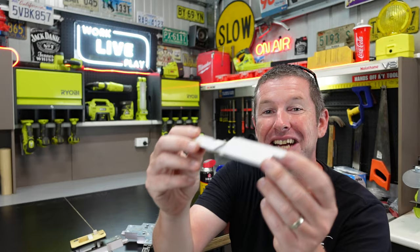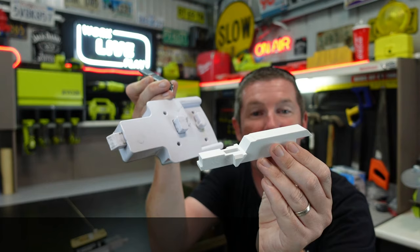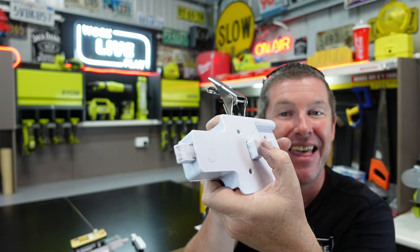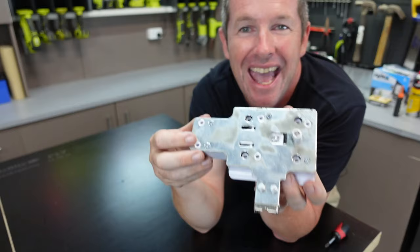A few people have come along with modifications where you fill in the grid on the back of these snibs to make them more solid. However, our good friend Royce from 3D Print RV actually makes these full solid replacement snibs that go into your Jayco handle mechanism — and these are the solution you can retrofit into your standard Jayco latching mechanism to make it last a lot longer. We're going to do this upgrade right now — it'll only take a few minutes — and while we're in there, we'll lubricate up this mechanism and I'll show you what you should and shouldn't do.